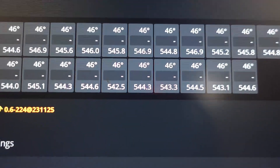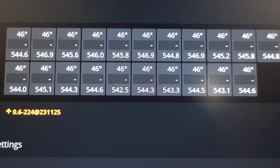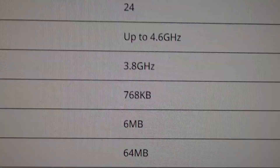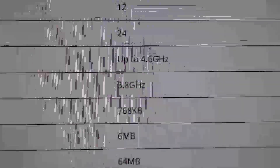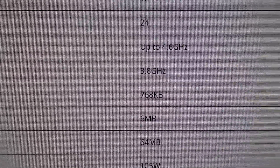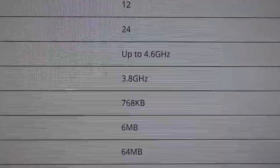I want to crank it up a bit to get a stable CPU, then enable the DRAM calculator timings and see what kind of hash rate we can get. Can we push 15 kilohash? I've done it in the past but I think that was only with two sticks. On AMD's website, the base clock is 3.8GHz and the boost goes up to 4.6GHz, so I might try 4.2 or 4.3. I might settle around 3.7 to 3.8 with tweaked voltages and two sticks with XMP on for Zeph.